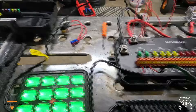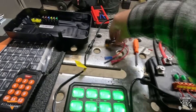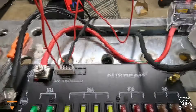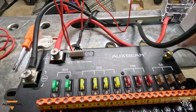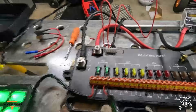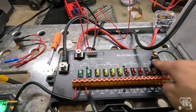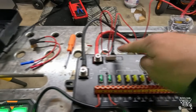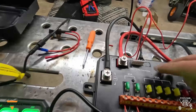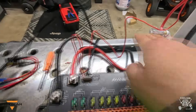Make sure that you wire in an accessory switch for the ignition so that your fuse panel goes off when the vehicle is off. Next, you can see that I've got the antenna wire — or radio wire — for the remote wired up right there. The antenna wire runs over to the panel and there's a click-connect right here on the panel. So to recap: the antenna wire, the panel wire, your ignition, your positive, your negative, and that's the switch.